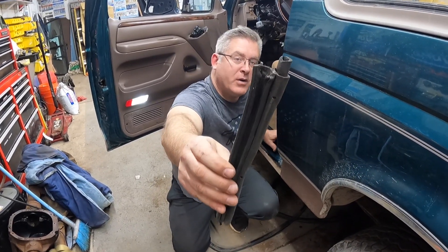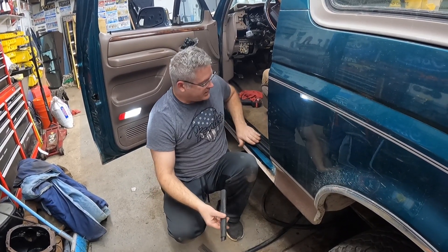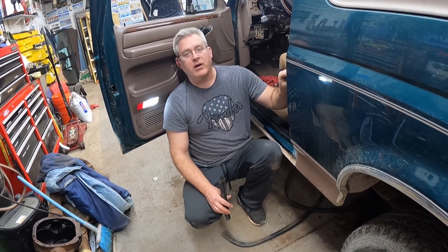That concludes our door seal video. Remember, this is what we started with — a seal that was pulled apart, rusting, torn, and flattened out — and we ended up with a nice new seal. I cleaned up the threshold a little bit. I've got to replace these screws and I'm going to be doing another carpet video. If you like what you've seen, please leave a comment below. If you didn't, go ahead and leave a comment too — I'm always willing to learn new stuff. Please like and subscribe. One last tip: if you're having trouble closing your door, it's because you have a new seal. You may need to adjust your door striker, and we'll do that in another video. See you soon.